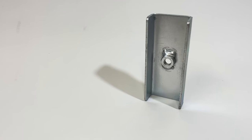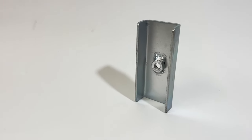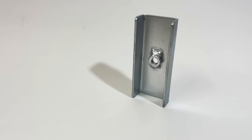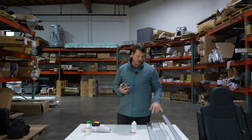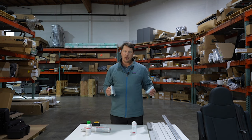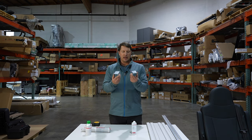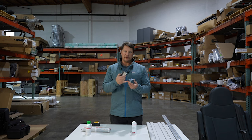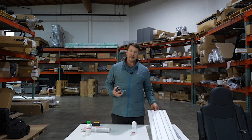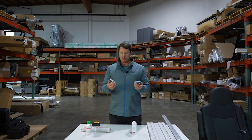The last thing you do is install the reinforcement anchors. You will drill two holes on the rear of the track — on the back two sections, in the direction of travel — drill holes and put in bolts that actually go underneath the van. You're getting a reinforced section of the van so that if the seat tries to pull out, these anchors are going to prevent it.